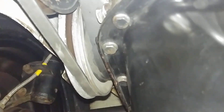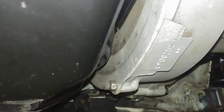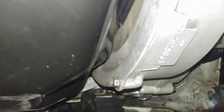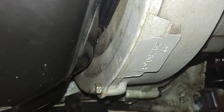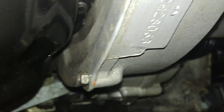The brake booster rod is adjustable and it had backed out. The booster rod is threaded and it backed out, so the master cylinder wasn't backing out completely when you let up on the pedals, meaning the fluid couldn't back into the reservoir. Until you know that, it was hard to figure out.